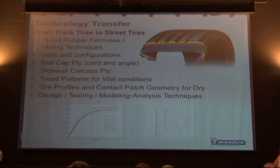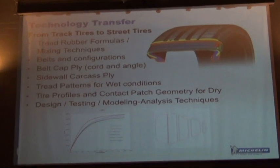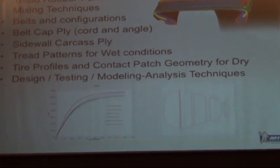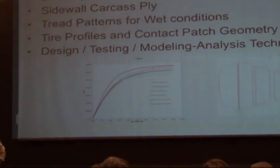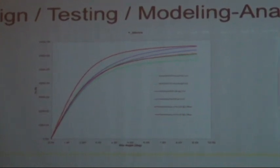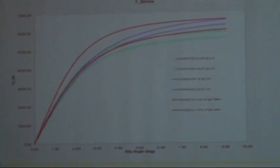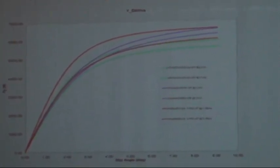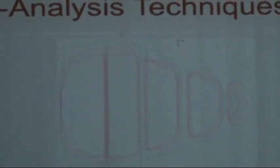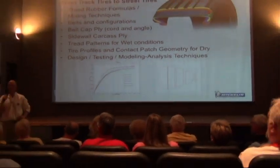Audience question about tire pressure: what kind of cold tire pressure should you work with to get the operating temperature to 212 degrees? As noted, it's very dependent on the driver, the surface condition of the road or racetrack. The aggregate used in road surfaces in Kentucky is very different from South Carolina. Michelin is located in South Carolina because of the wear rate — the roads there have such high grip that tires wear out faster than anywhere else in the US, due to the granite in Georgia, South Carolina, and North Carolina.